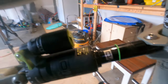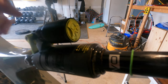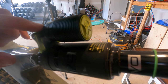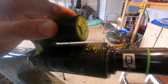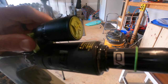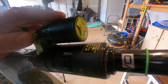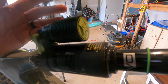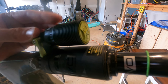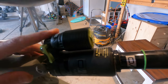The one thing that is proprietary is this additional upper canister air pressure dial. This is really sensitive to fine-tune the overall feel of the shock. It says between 170 and 200 psi. Note: when you put the air pump in there, it will immediately allow a little bit of that ghost air to come out and then read way lower. I thought it wasn't holding air, but my local bike shop talked to DVO and they said no, that's normal — get it all the way up to your desired setting, pull it off, set it, and then just keep an eye on whether you're blowing through all your travel.